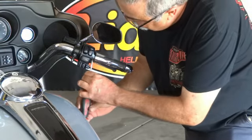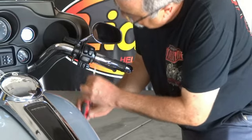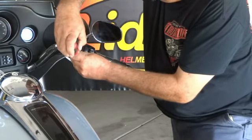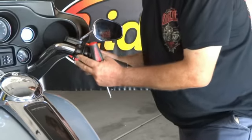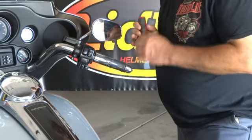So put in the top one, the bottom one, just get them in, and then your front brake bolts, get them in place. And then let's just double check again. You can slide this whole assembly in and out. Just slide it in, just boom, till it bottoms out, just like that.